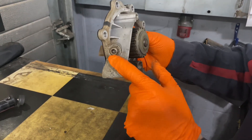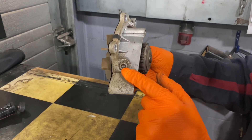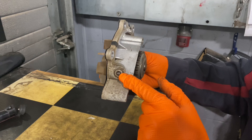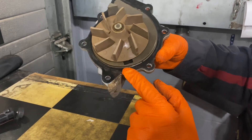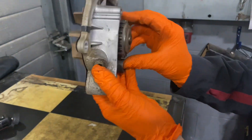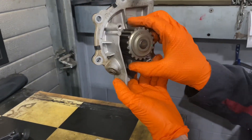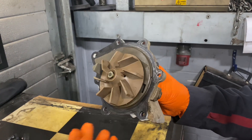On the side there's a drain plug. I reckon you could take that out, and if you've got a good enough inspection camera or bore scope, get the camera and a bit of welding rod, thread it through that hole, and — obviously keeping the cam belt in place — pulse up the engine and see if you can move that. Maybe a way of testing it without full stripdown.